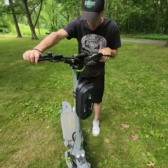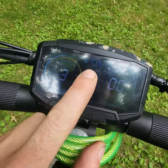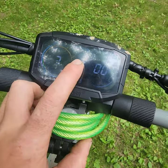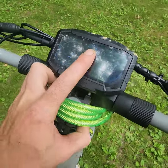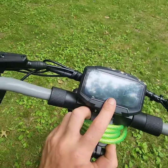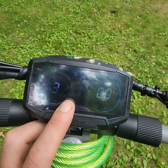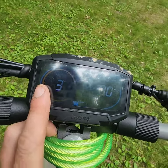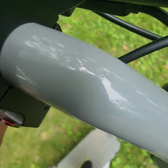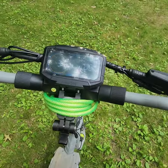Keep in mind we have a 57.9-volt battery and the cutoff voltage is 49 volts. I want to push it — it'll probably flash under some load — but I'm going to go through speeds one through three on single motor first, then turn on dual motor and show you one through three again.